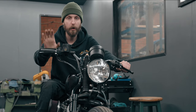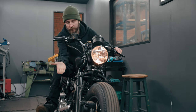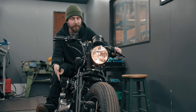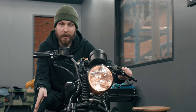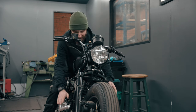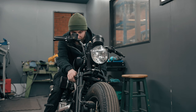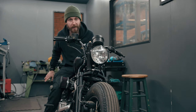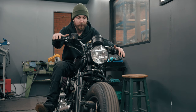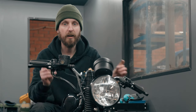The handlebars are on, other than one grip I need to change to match the new grip. As you can see, or not see, the indicator is not working — they show on the dash, but these indicators are not plugged in. I don't like them anyway. We're going to change the indicators for something a little bit better in a better position, because down here is where they are for some reason. The front ones we're actually going to be putting up here, and on the back we're going to have indicator and brake lights integrated into one — two bulbs. That should make it look a little bit cleaner, smoother, simplified, and just a bit cooler.